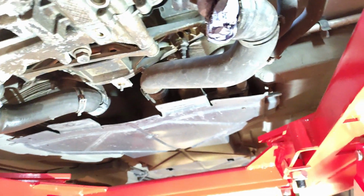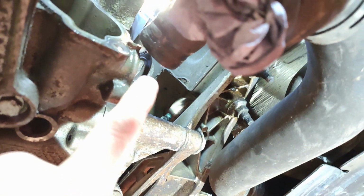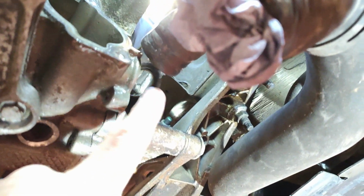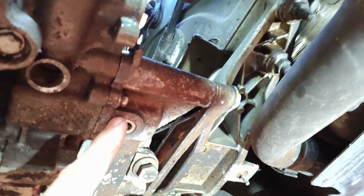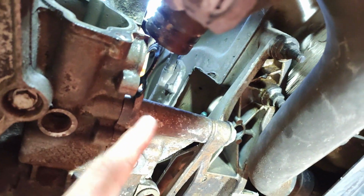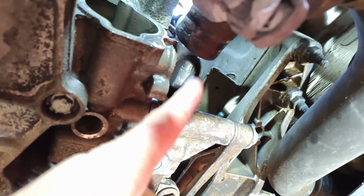okay, so back underneath the car, this is going to be a little bit shaky, and I'll probably come at it from the top when I move the car around after I clean it off. But I don't know if you can see it. Here's where the stat was, and there is where the pump was. Now this gasket is still attached to the cooling manifold. When Porsche assemble the block or the engine, it's all one gasket, so this will have to be broken.